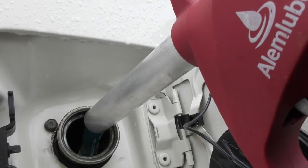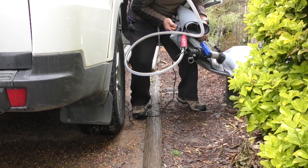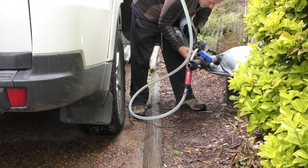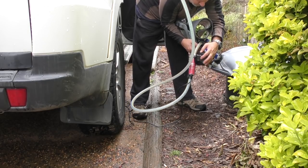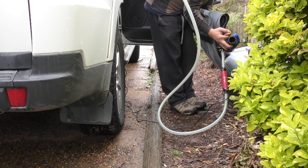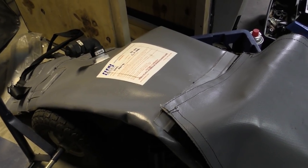As far as time frame goes for pumping the fuel out, it only took about four minutes — probably not even — to decant that 40 litres into the vehicle. Very, very quick. One thing I found was that I wasn't able to get all the diesel back out. I went to put the tank in the shed and realised there was still some fuel in it. I took it back out, placed it beside the vehicle, tried to situate it so the diesel was near the output, and got a few more litres out. But I reckon there's probably still at least another four litres inside the bladder. Not terrible, but not perfect. Maybe someone can share a technique for getting all the fuel out of these.